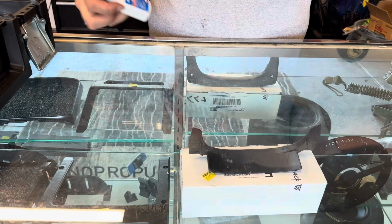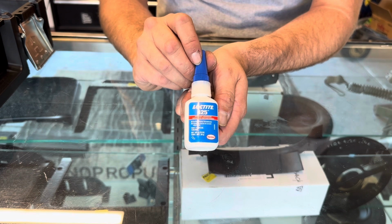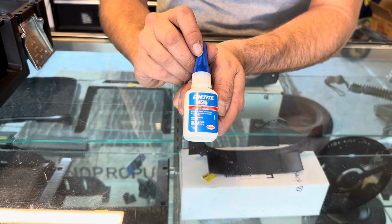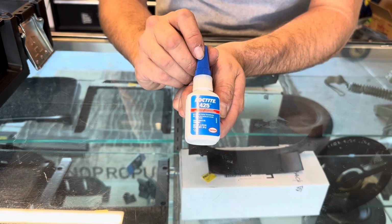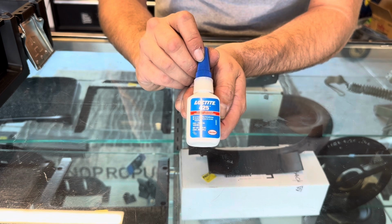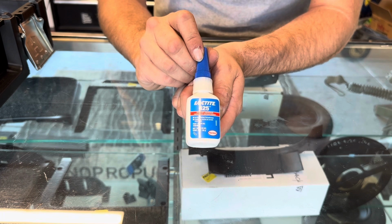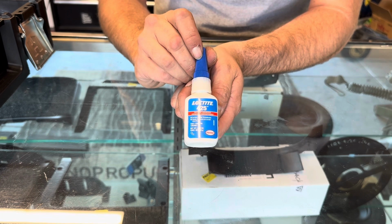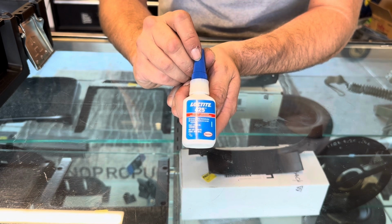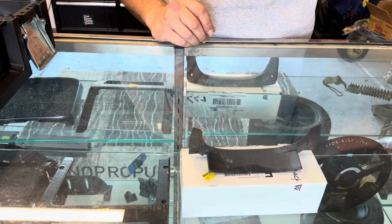And then while we're on the Loctite, 425 is great for plastic. So there are a few places, specifically on the Onewheel GT and pints. Actually, I don't know if the pint is plastic or not now that I think about it, but on the GTs, inside the main board, the controller, or the printed circuit board, it's great to go through, and I did a whole video on this, how to apply this Loctite where Future Motion doesn't, to make sure that your screws don't back out and short your board out. But that's kind of a specific thing. Don't use it all that often.